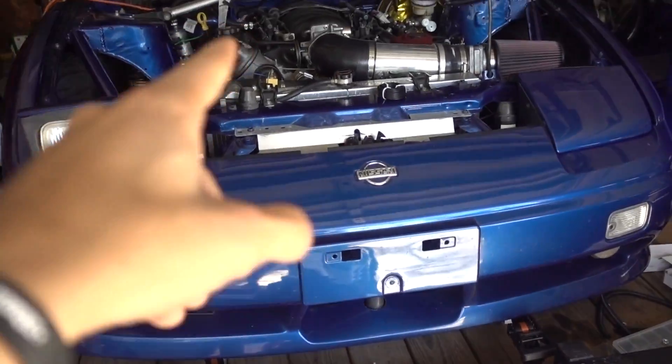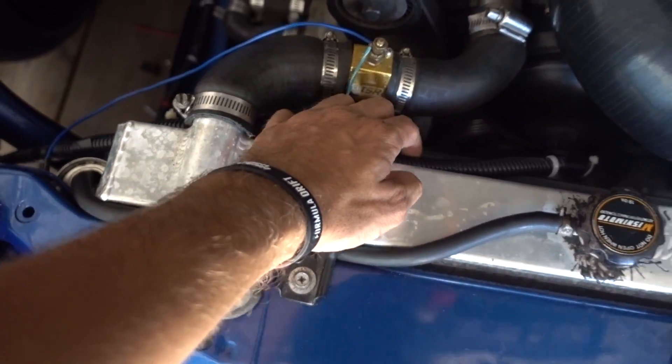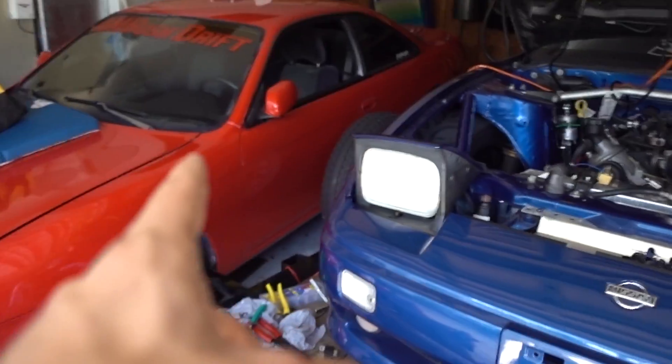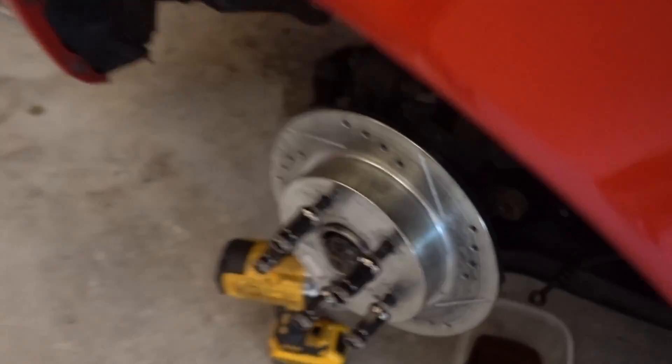As far as other updates I haven't covered since I haven't been filming: last weekend I finished up rewiring a new relay for my electric fans and also covered them in a nice loom, so that car should be good to go. And with the S14, last weekend I took off my rear passenger side caliper because when I was trying to bleed the brakes, I completely broke off the bleeder bolt. I have a new caliper waiting to be installed so I can start dailying this thing again.